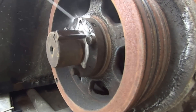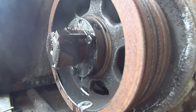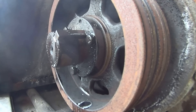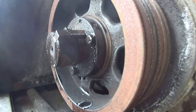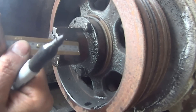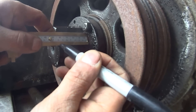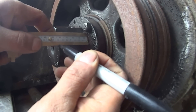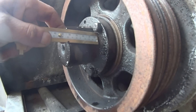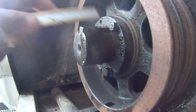Okay, so first thing I'm going to do is spray this down. I know that this pulley is aligned properly because it's the original one, and just to save myself time, I'm going to mark it and see where it is so I don't have to waste time aligning it. Just a little trick.